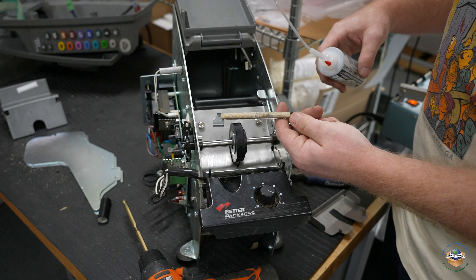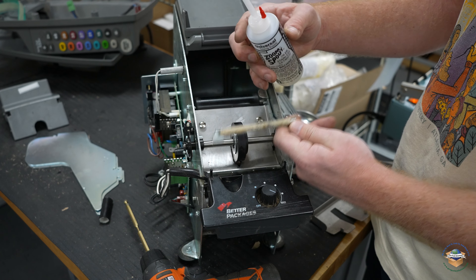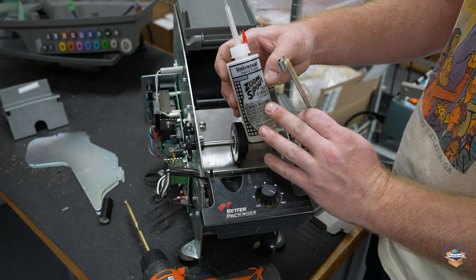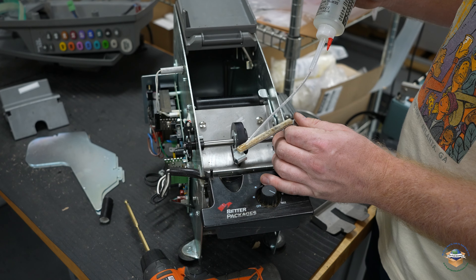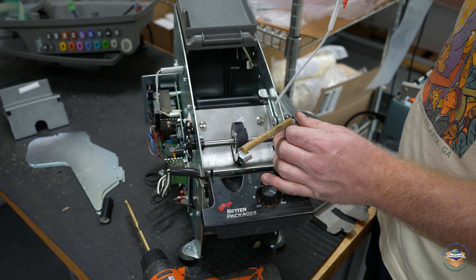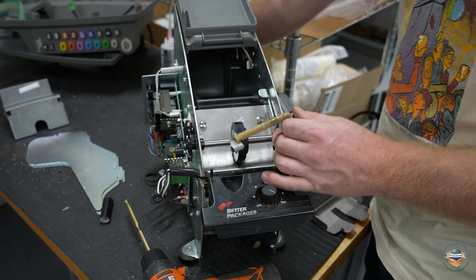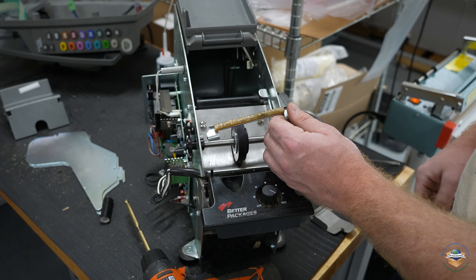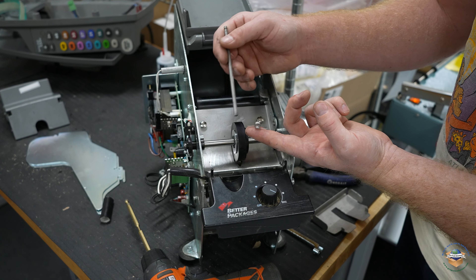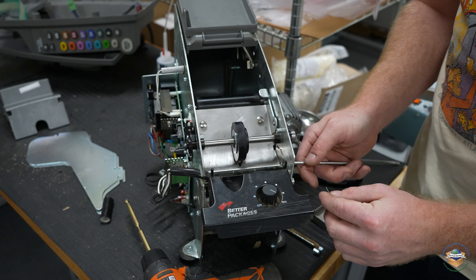We can plug that heater in. Next we're going to put this felt pad back in, but first we're going to oil it. This is the oil that we use — Zoom Spout oil, it's a light machine oil, actually sewing machine oil. You just want to soak this felt pad in oil. It is possible to over-oil this felt pad — if that happens, you can take a piece of tape and on the outside of the tape, not the gum side, you can soak up some of that excess oil. Now we're going to start with this spring — this spring has two little wings on it and you want those on the downward side of the spring.